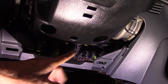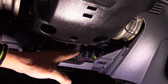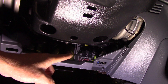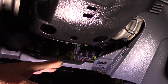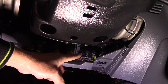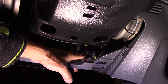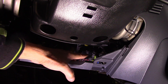He told me he already checked the circuit, everything - the window motor, the window regulator - all good. But somehow he doesn't know why. He just put the fuse in and it broke, put another one, broke. Broken right away - that means it shorts directly to ground, not an overload blown fuse. For overload, for example, the window is hard to move up and down, more load on the motor, more current, and it'll blow the fuse. But he told me turn the key on and it broke - that means short to ground. He put about a few fuses in, but he's a mechanic, he knows if he keeps putting fuses in, they'll all be gone.